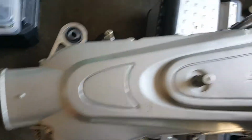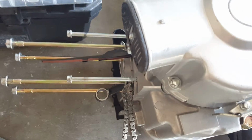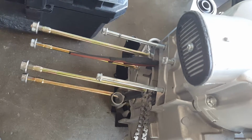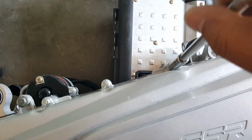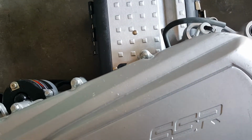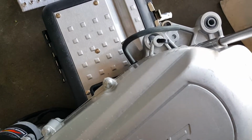Again, also on the piston's head, I called the manufacturer to see about the indication of where the arrow should point for the pistons, and they said it actually points down to the exhaust. So the EX definitely was exhaust. I second guessed it myself because I didn't think aesthetically it looked really great, because when you point the exhaust to the bottom, it pretty much turns the piston and the 63 millimeter engraving upside down, which is necessary. It has to be that way, I guess.